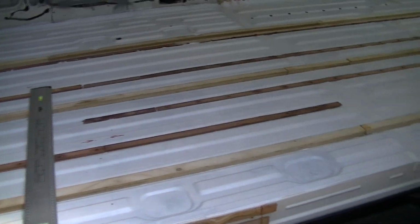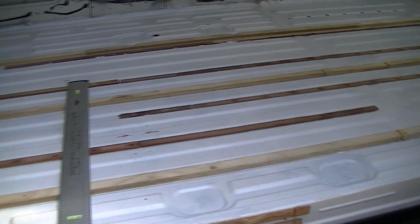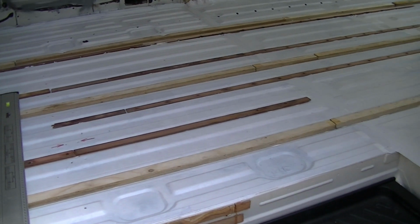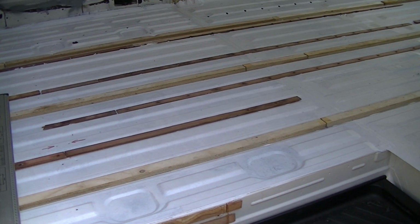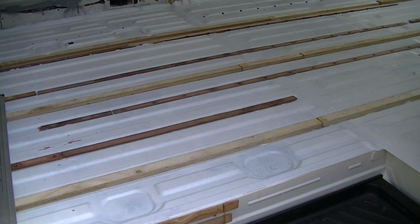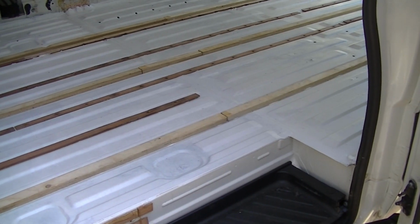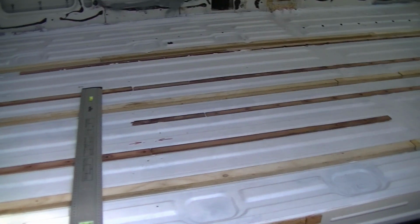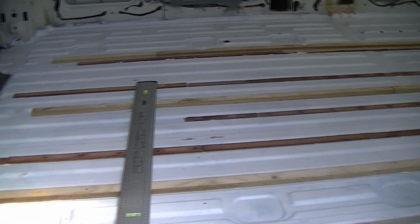The other one that really matters is the one down the centre, because I'm just spreading the weight out. Otherwise there will be almost a 20mm gap for the flooring to potentially sink into over time, or crush the PIR down over time. The other furrings on the sides are less important. It's just that I had the material, already cut to size, so I've used it.